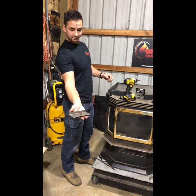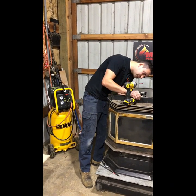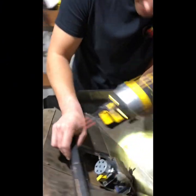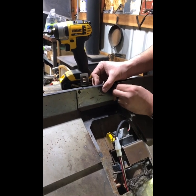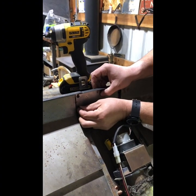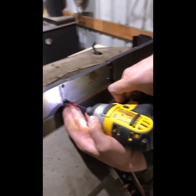At this point of the installation, we are going to finish up the adapter plates. Briggs is going to reinstall the face plate — remember it had to be removed to take the whole auger motor and shaft assembly out. He's putting the four screws in by hand, holding on to them tightly, because if you lose one of those screws it goes way down underneath the hopper and you won't get it back.